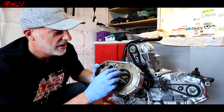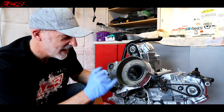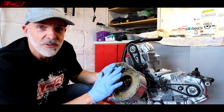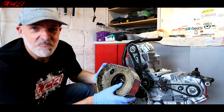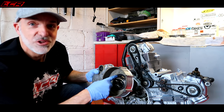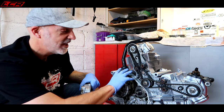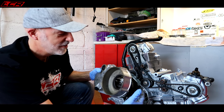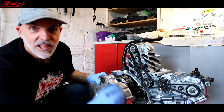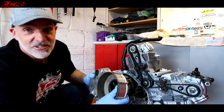Now I've got to strip the casings down further - remove things like these O-rings. I've even got to remove the sight glass from the casing. There's a temperature sender here as well for oil temperature, so all that's got to come out. This is getting more complex than I thought it was going to be. That's the trouble with having a dry clutch - obviously there's got to be an oil seal between the clutch and the internal parts of the engine, whereas normally on a wet clutch you just take the casing off. But it's split between a dry and a wet area, so you've got to replace bearings to keep that oil seal.